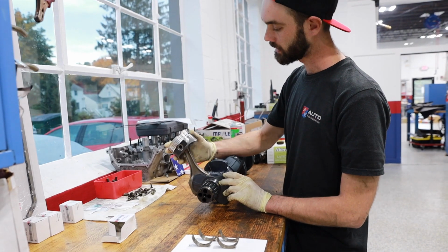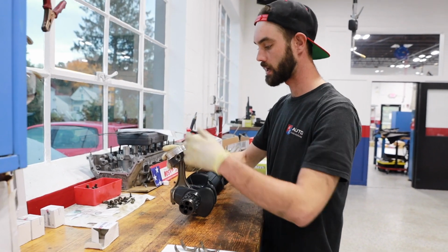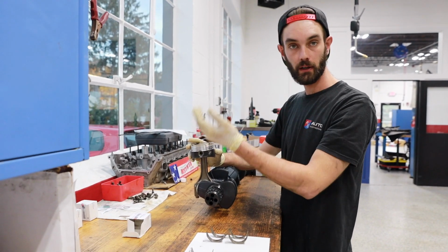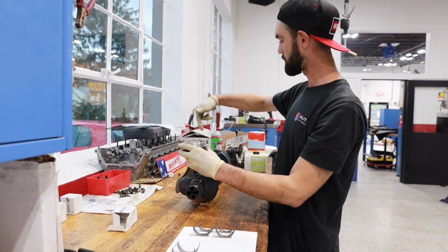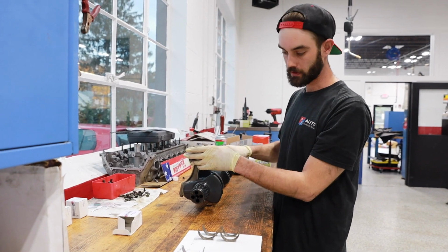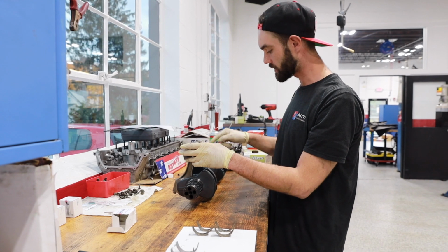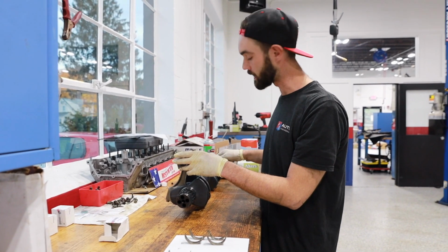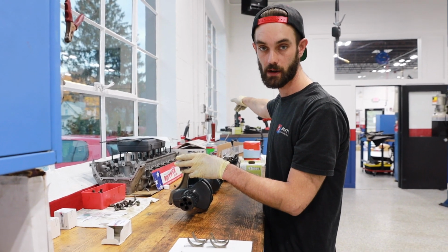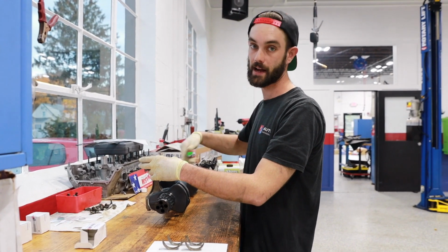This is your basic fundamentals of internal combustion engines. You have spark and fuel going on in the combustion chamber. That's going to force this piston down. Times 6, you're going to have this crankshaft start rotating real fast. And this crankshaft is connected to your clutch, goes through your transmission, through all your gears, and then eventually all the way to the rear tires and your differential. That's how you get power. This thing's spinning at 8,000 RPM.